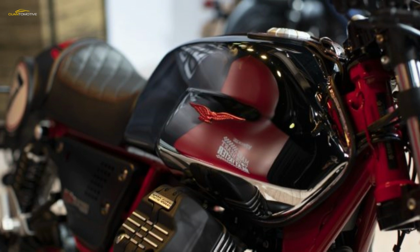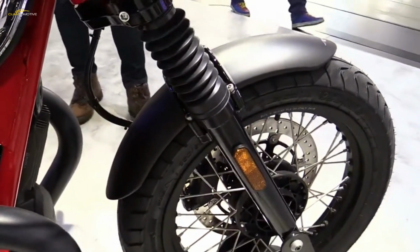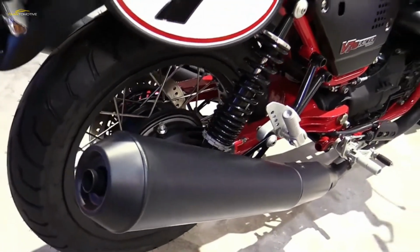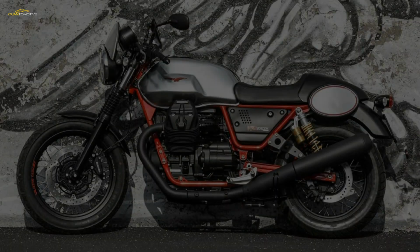The oil pump also saw some tweaks to reduce the power it absorbs, and the addition of piston cooling jets that spray pressurized oil onto the bottom side of the piston crowns should help mitigate the heat and stabilize the pistons to help prevent galling and scoring.